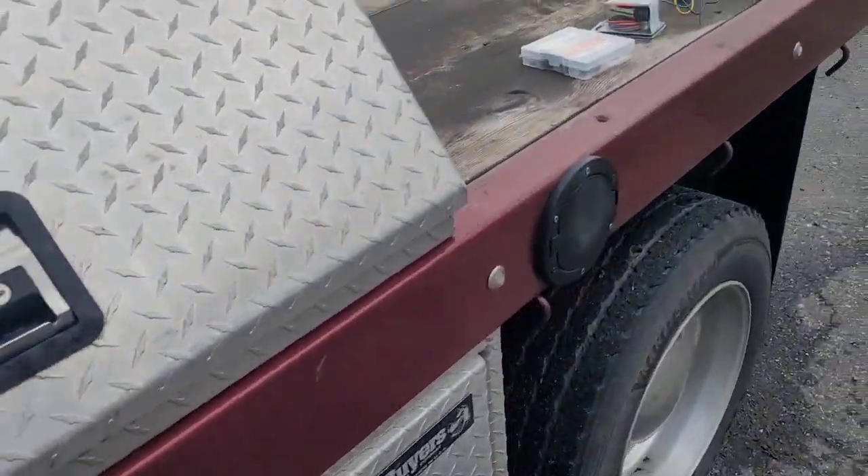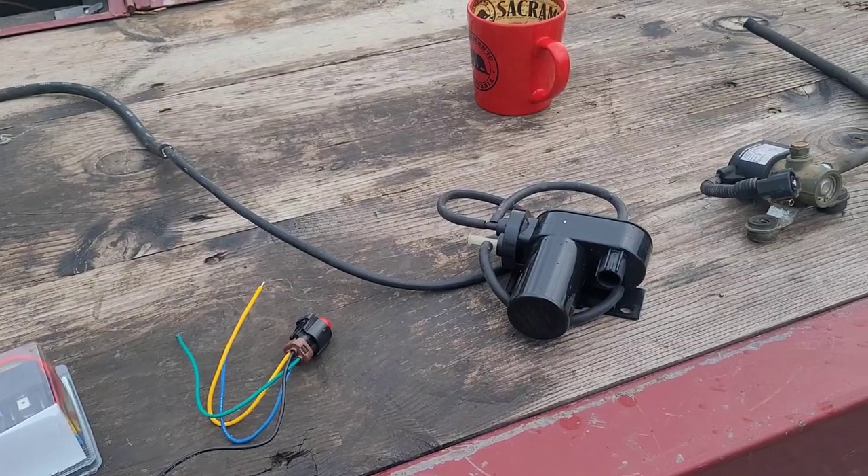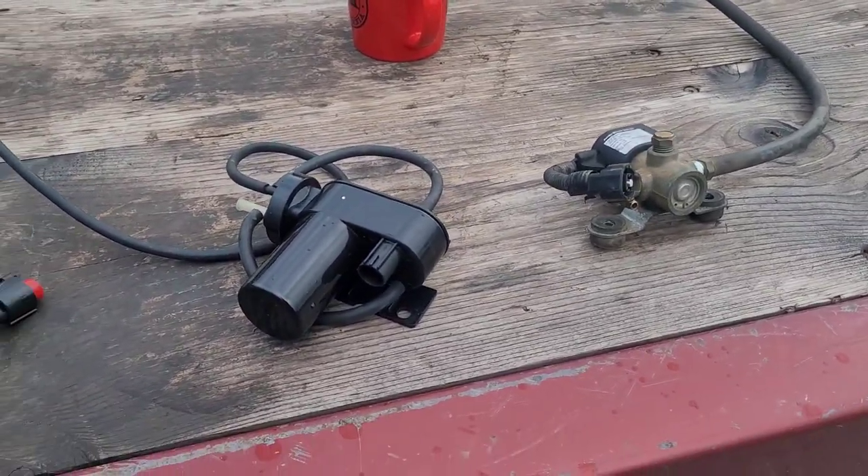As most of you probably know, third-gens don't have a vacuum pump. On the HVAC systems they're all electric, so you've got no vacuum. How Jacobs did that was they had what looked like a Power Stroke vacuum pump that bolted on over there on the driver's side front of the engine, and you actually did run a Power Stroke belt. That little belt-driven mechanical vacuum pump — guys had a lot of problems. If you Google that you'll find all kinds of issues with them going out at not a lot of miles. Gino's Garage does carry them still, but they're really expensive. And I don't really like not having a factory belt — I don't want a Power Stroke belt on my Dodge.